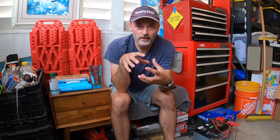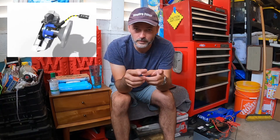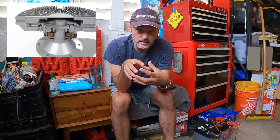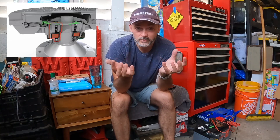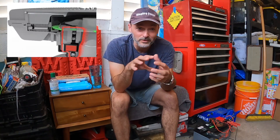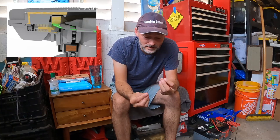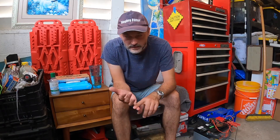How does this thing even work? The actual hub of the fan — the metal part with all the cooling vanes — is a mechanical coupling. It operates based on a signal from the car's ECU. That cable we removed when we took it out — that's where the signal comes from. This signal causes a valve inside the coupling to open and close, which in turn causes the fluid to release. As the fluid flows out from the hub it grips more and more on the driven side of the pulley, so it spins up faster and faster, increasing the amount of air drawn over your radiators and increasing cooling for the engine, cooling system, and air conditioning.